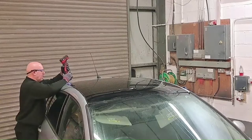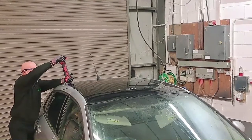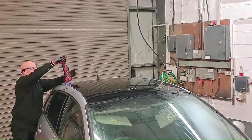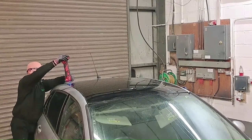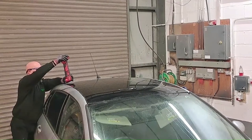Just like with the rest of the glass when you're cutting it out, be careful not to damage the paintwork — just keep the blade tight to the glass edge. The glass is already broken so it doesn't matter if it breaks even further. I've got the biggest blade on here and you can feel it straight away that it's actually catching the glue, so I'm hoping it'll get right through so we can cut the whole glass out from the outside and just lift it straight out.